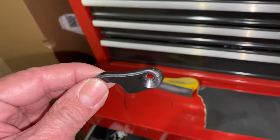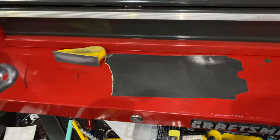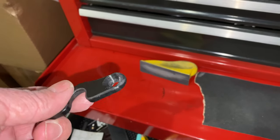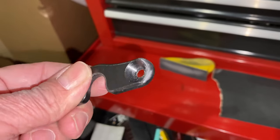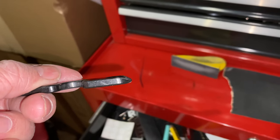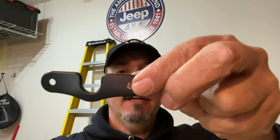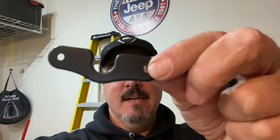Here's where we're at — put a nice little bevel on there. I used some scrap 150-grit sandpaper and a little finishing tool with 600-grit just to clean it up. I'll probably hit it a little more before installing, but you get the general idea — just a bevel like that and it will clear the visor. There is one version that only secures on one side — imagine a hook shape instead of the beveled side. That version is about $20; what I bought was $30, hoping it would give a little more rigidity and help the visor not break.